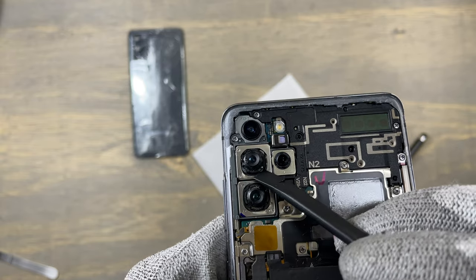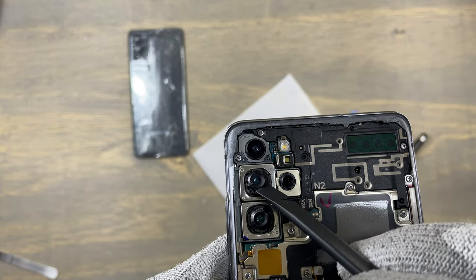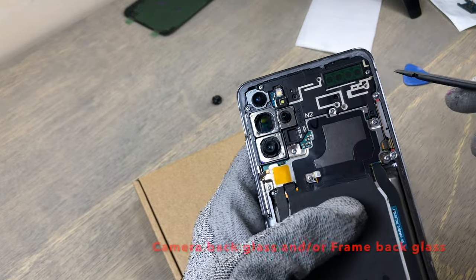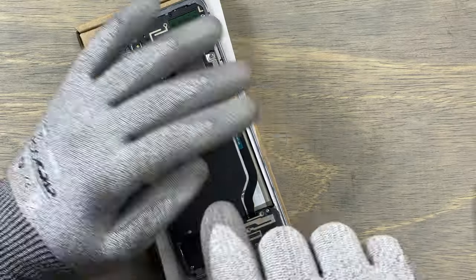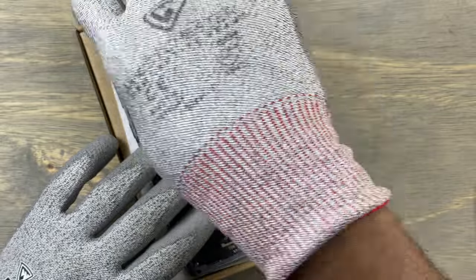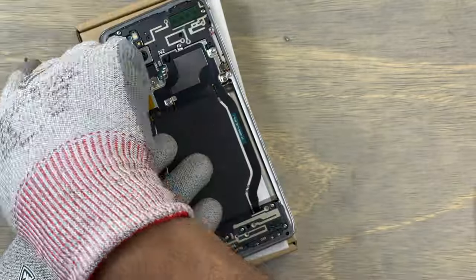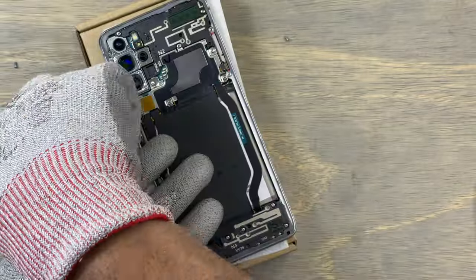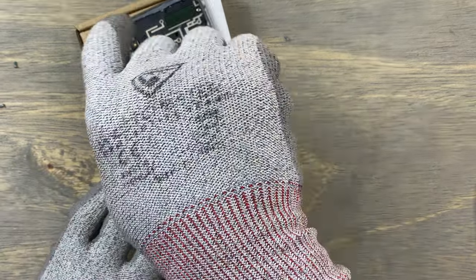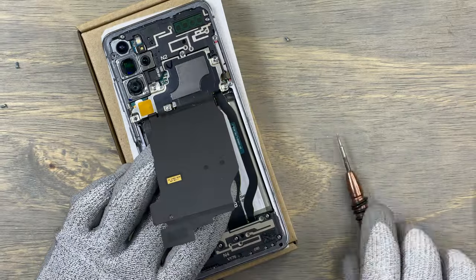I opened the main camera to check what's going on with the sensor. The advice here is to replace the back glass as soon as it is broken. Remove all the screws that you see — we are going to take out the motherboard to inspect the cameras further. Links for the tools I use are in the description. When your camera is blurred, it can be a lot of things — the housing of the camera can be broken.